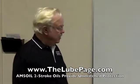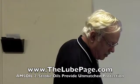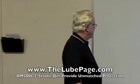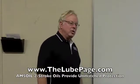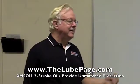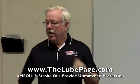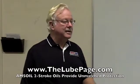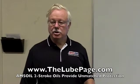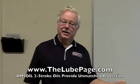So we come along with these new oils, and he goes in here talking to them about what lubricity means and what we want to do. But really, what we have to rely upon is the oil film that is in the gasoline when it gets on the metal surface will have enough ability to prevent metal-to-metal contact. No different than any other lubricating application. It's just that it has to be able to do it and withstand the contamination, if you will, of gasoline, and do it at the same time.